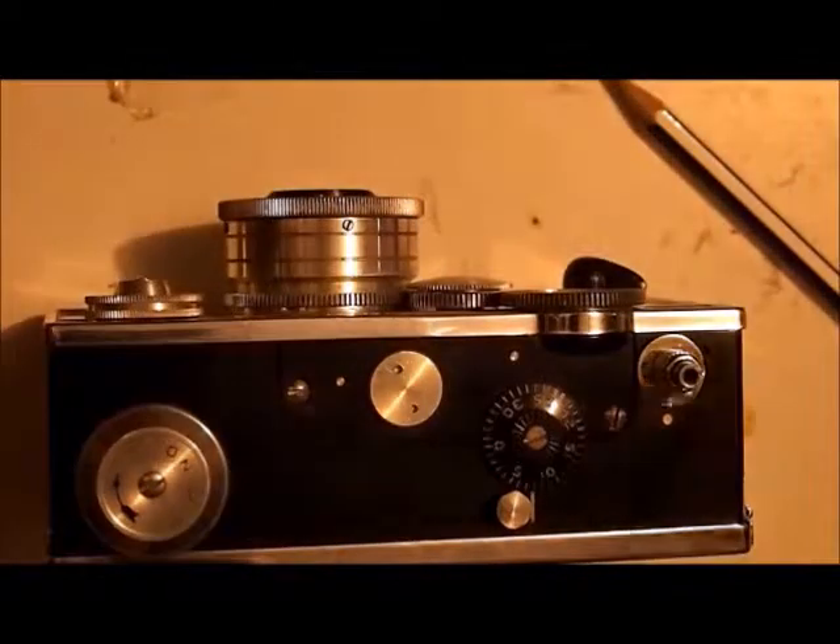Let me show you how to use it. You can see in this picture that the top half is clear, and the bottom half is yellow or blue, depending on the age of the camera. In this next picture, you can see that this white pole is cut in half and crooked. By simply turning the rangefinder dial or lens to and fro, the two halves of the camera come together and make the image one whole. Now you can see that the pole is centered — this means that the rangefinder dial is in focus, which means that the lens is in focus. After you focus the rangefinder and lens, look through the left window and compose your image. You can see that I am composing an ironing board here.